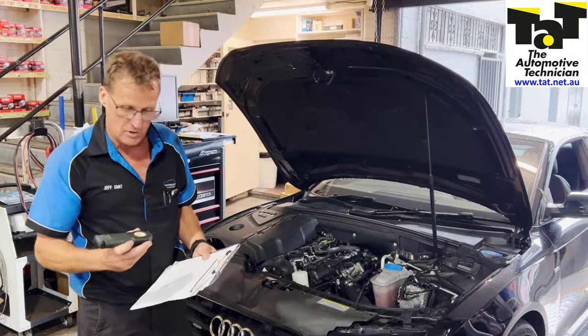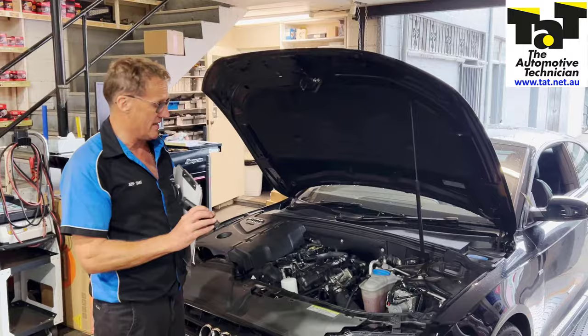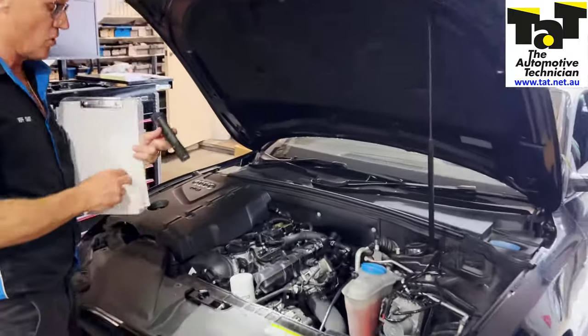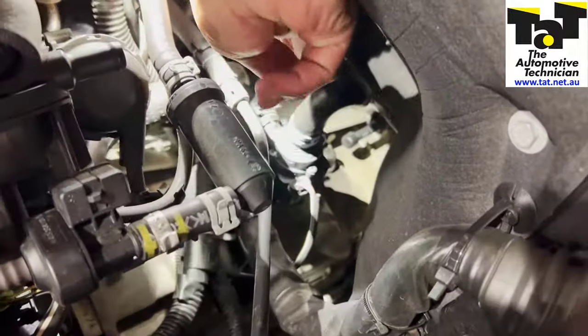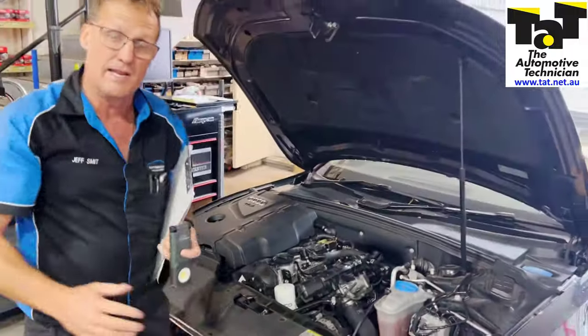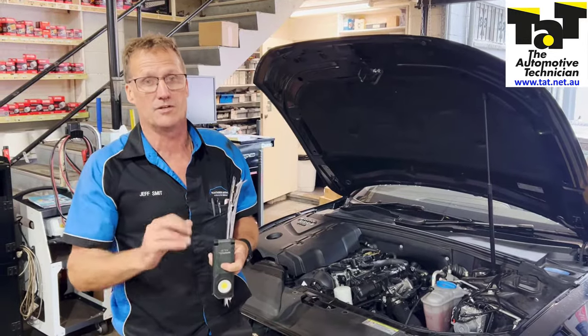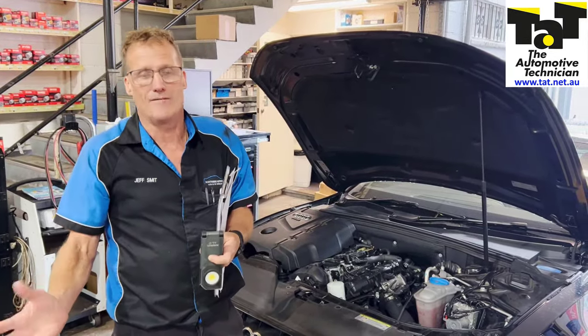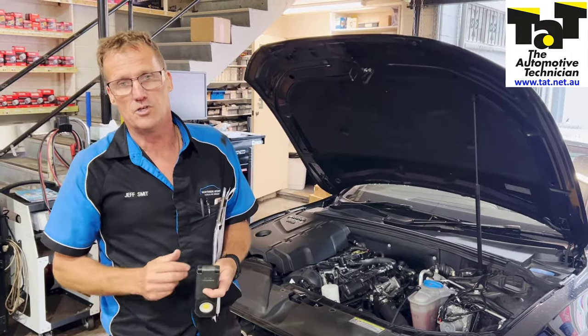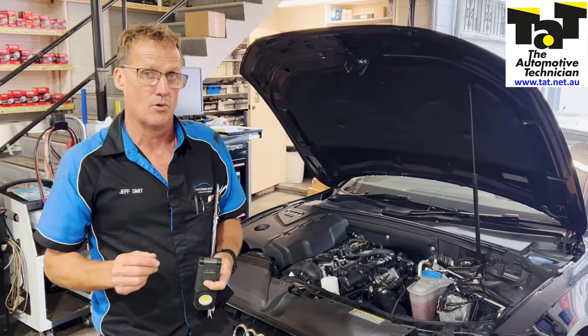The vehicle runs three water pumps basically — the mechanical water pump, which is conventional, and then two electric pumps which keep water flowing at different times, including when the car is in a stop-start situation. We've got a pump at the back of the engine here, an electric pump, and one tucked underneath the manifold down the bottom. In this particular case, it's the one underneath that inlet manifold that's now open circuit, so we're not getting water circulation under certain circumstances, especially under stop-start conditions when the engine is off and the water pump isn't flowing. We need those little electric pumps to make sure the coolant's flowing around where it needs to go.